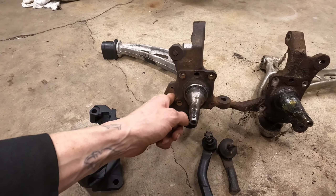Clean, prep, ready for paint. Quickly slap a few coats of paint on here, get them looking beautiful. Bolt the two halves back together, throw them in the car — connect the lines, bleed the brakes, and we are done. Just like that, they are painted. It's the next day for me, but you can tell — this black background and masking worked killer. We can see how clean the holes were kept, absolutely perfect. Just got to peel the tape off, mate them together, Loctite them, torque them, and onto the car they go.